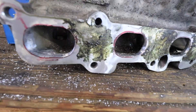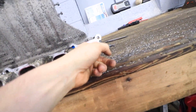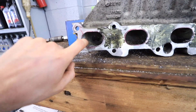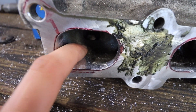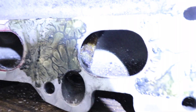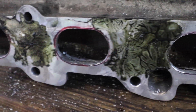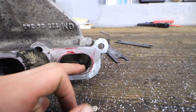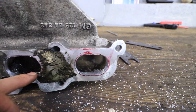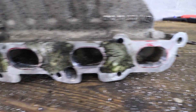Smooth those bad boys out — bulk of it is done with the carbide. Now with the top it's totally different. The bottom is pretty much just those lips going down, except for one side where I really had to dig in. But the tops have a lot more bumps — you can kind of see the bump here, then there's a ridge, and then bumps on the side too; there's just a lot going on on the top to smooth out. But it wasn't too hard — all this was pretty quick with the carbide. At this point I'm just gonna smooth it out with sandpaper so there are no ridges and no more lips from where I cut with the carbide and dug in one area without going all the way around.